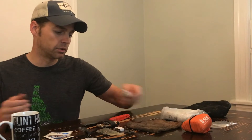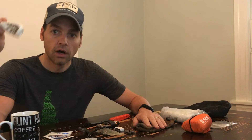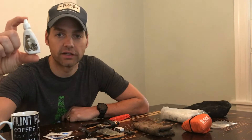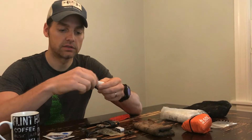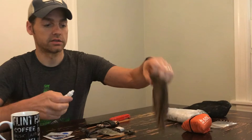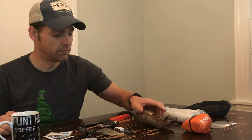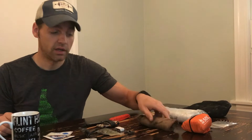Another thing that is super important on long routes like this is having some way to keep your chain lubed. I'm a big fan of Pro Gold Extreme lube. Unfortunately, Pro Gold only comes in four-ounce bottles or these little sample packets, which isn't really conducive to taking along with you. So what I do is I've taken an old Visine bottle, filled it up with Pro Gold, and it has a nice little dropper applicator that makes it really easy to reapply to your chain. The seal on it is really good, so there's not a lot of leakage. I'll roll it up in a microfiber towel so I can apply it, wipe off the excess, and get on my way. That worked really well in Arizona last year — it's a half-ounce or maybe quarter-ounce bottle and I didn't use all of it.